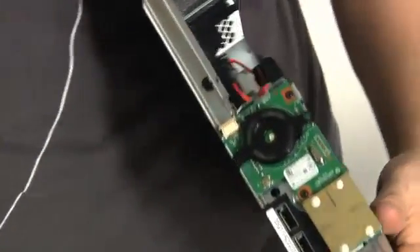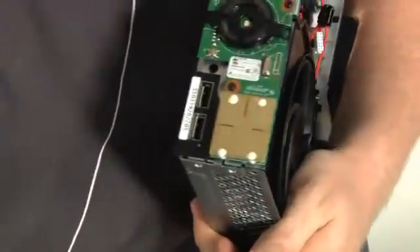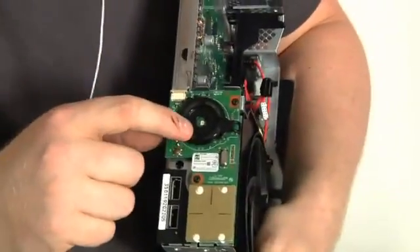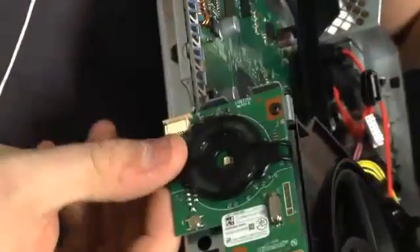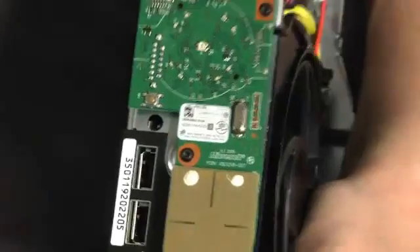You can see the difference on the front panel buttons. The old Xbox has lights that are shown up through the board — the lights are actually on the board and these are just kind of diffusers that show through the bezel to show you the green or red rings. The physical button is right there on the old one. This is actually a new thing — there's no physical button on the new design. It's all just a capacitive touch sensor on the front. The lights are still there around the edges, plus there's a light in the sensor, but the button's gone.